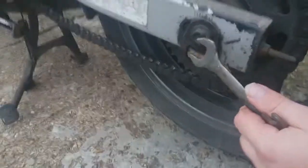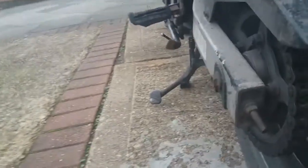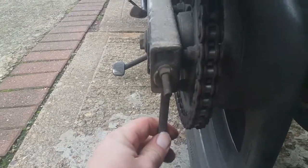I'm going to go from the front upwards half a turn each time. Same goes for this one but go from the top turning it downwards half a turn each time, until the chain doesn't look so slack. Just before — once you've undone the nut over there — take the 17mm spanner and give this a bit of a move so it makes it easier to manoeuvre. Right, so now with the 12mm, do it half a turn — go from there, go up half a turn.